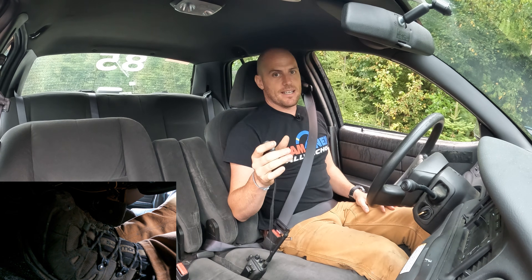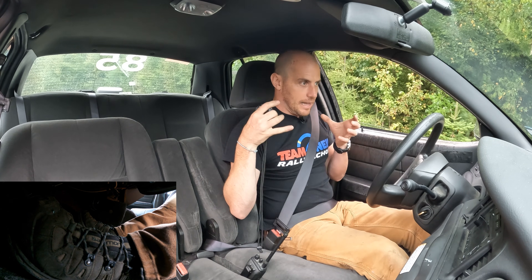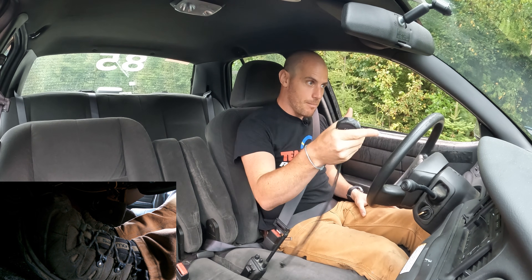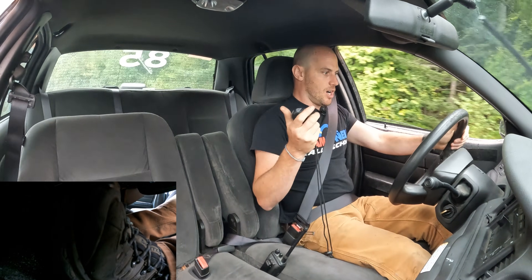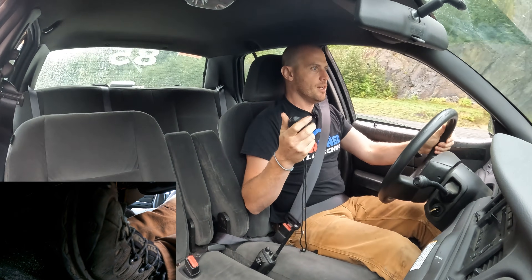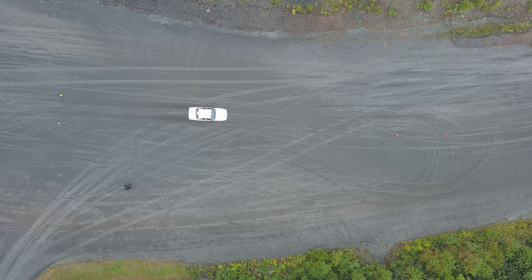Round three — deactivated the ABS, and we're going to go full wheel lockup. Three, two, one — stand on the brake pedal, let the wheels lock, and let that come to a screeching, skidding halt, and see how quickly we stop from 50 to zero on a gravel road. There's 50 on our calibrated speedometer. Three, two, one, stop. 3.87 seconds — so call it 3.9. I'll put a cone by the tire.